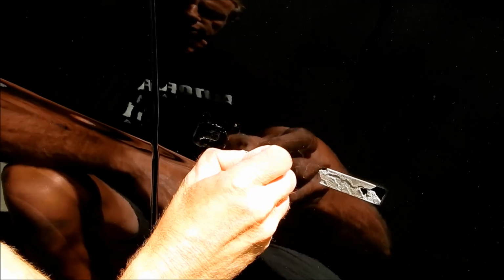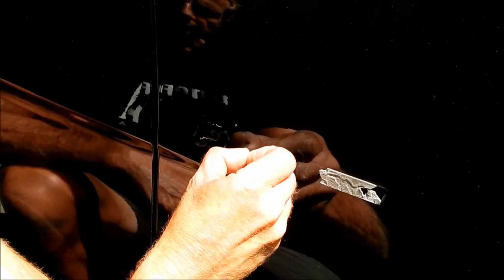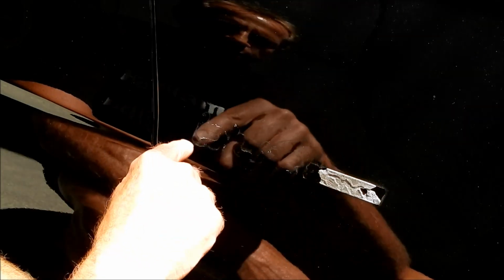It's pretty straightforward. Some additional rules: if you're a do-it-yourselfer, the sooner you take this off, the better. So if you want to wait 2, 3, 5, 9 years, whatever, to take this off, you've got to understand that there's some drawbacks to that. There will be a shadow. Always there will be a shadow left, because this paint that is uncovered and continually exposed to the UV lighting will fade, and now when you take the emblem off, you will have a permanent shadow. You will not, in most cases, be able to even polish or wet sand that shadow away completely.